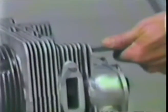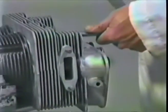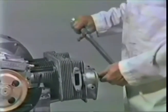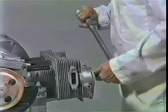So I find if you torque it this way, with the blue Loctite on the nuts, and do it 3 times in succession, that's as good as retorquing after the thing is warm. It really isn't quite, but like I say, nobody retorques these things after they've been fired up. It's too much hassle to take off the intake manifold to get to these, and the cylinder shrouds to get to these top nuts.